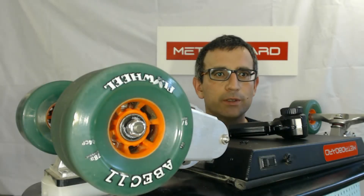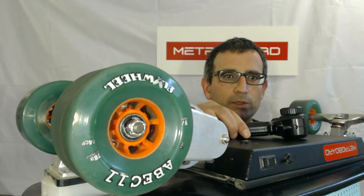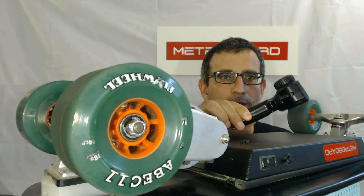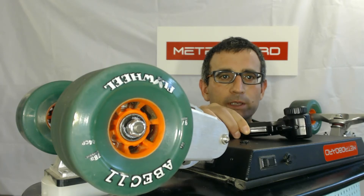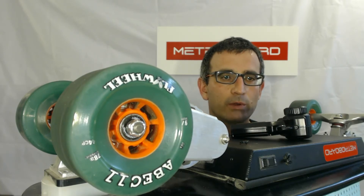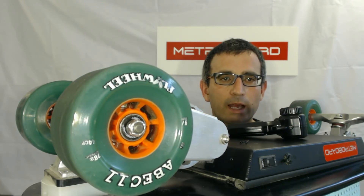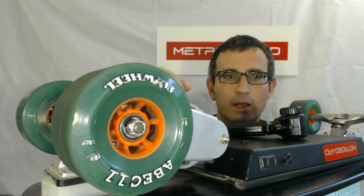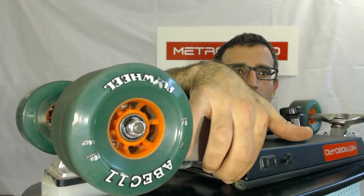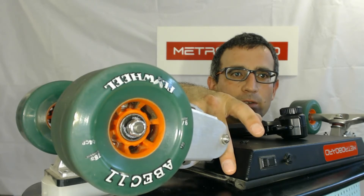The other thing I wanted to show you today is how to rebind a new RC remote — either if you lose your remote and we send you a replacement, you're going to need to rebind it so that the receiver on the skateboard will accept the signal from the new remote. As you may notice here — it's not obvious — but there's a little bind extension connector right here, basically on the back of the battery box kind of facing the drive wheel.